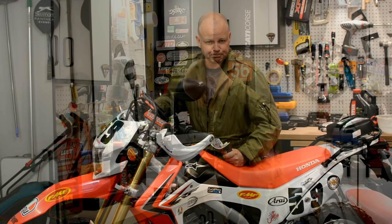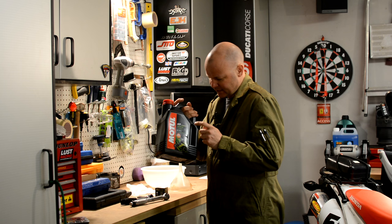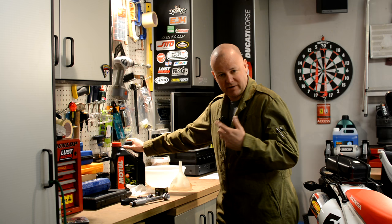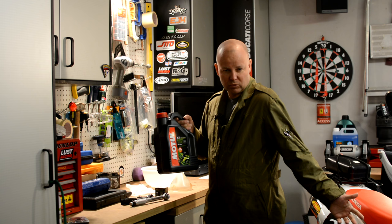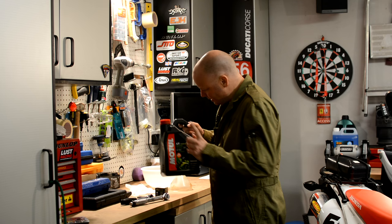So what do you need in order to do the filter and oil change on your bike? Of course you need a filter and you need some oil. The oil I've gone for is semi-synthetic 10w40, which is pretty standard motorcycle type oil. It's not fully synthetic — fully synthetic oils are very high spec and high grade but also very expensive. Semi-synthetic has some mineral oil in it but it's perfectly adequate for this sort of machine. Rather than agonizing over the type of oil, making sure you've got clean and regular oil changes is probably the most important thing. Always go for a known brand though — Motul actually invented semi-synthetic motor oil back in the 1960s, so I always trust their stuff.